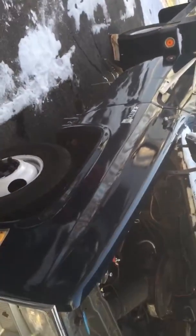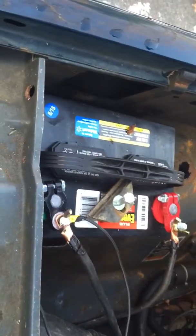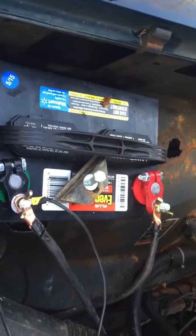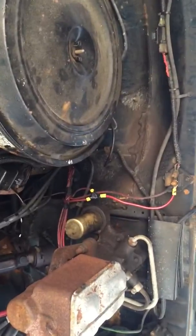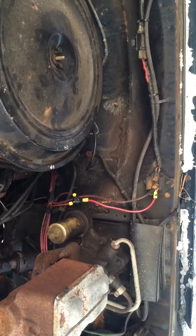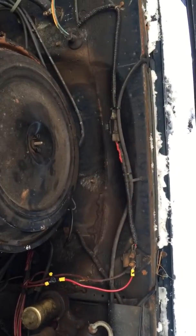Trying an ice-cold start on a 1984 GMC 3500. We had some issues with this truck — the battery was weak, so we put a new battery in it, Walmart special. I then put marine grade terminals with crimp-on connectors and put the new battery on it. It still wouldn't start and tested everything okay. I had no gauges, only headlights. Turns out that wire coming down off the stud on the firewall with the new three-way connector was completely blown off.